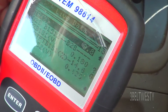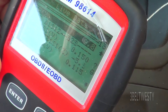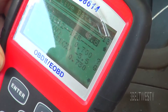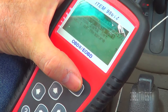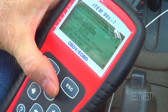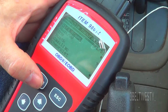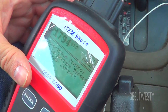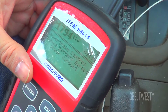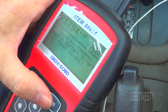Got a little shake here because it's only down about 600 RPM. Got the check engine light on. The check engine light came on — we'll see if we got some codes. Read codes. Manufacturer-specific codes are found. Powertrain control module, battery direct power circuit. What the hell is that? Maybe there's a bad ground somewhere.